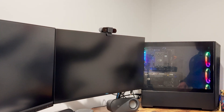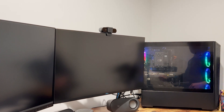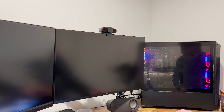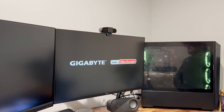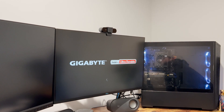Now it's time for our first startup after all the upgrades. Everything powers on perfectly right away, CPU fan spinning — we're good. It does take a little while to boot up and show the splash screen, as it relearns the new memory configuration, but once it does everything boots right up. We see the Gigabyte splash screen and eventually the Windows 11 home screen. Now that we're booted up, it's time to do some testing.